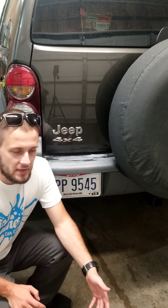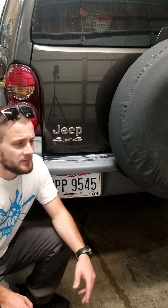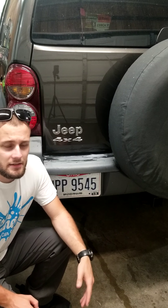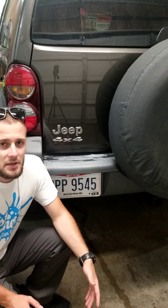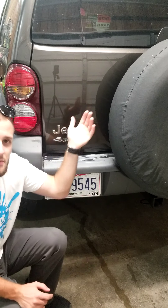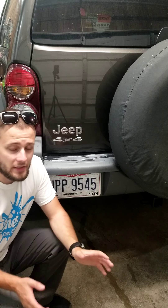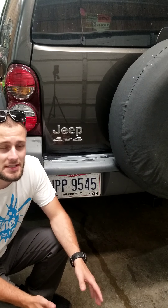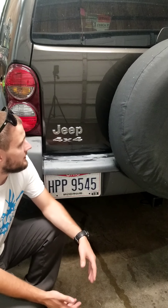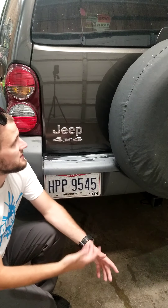Something I've had happen quite a few times is a client would say, 'I had XYZ person do my car, it looked really great for three or four weeks, and then it looked like they waxed it while it was dirty — I started seeing all these little tiny scratches.' Well, that's because wax is a lot like makeup. Wax will fill in the pores of the paint, and then as it breaks down over time — a legit carnauba-based wax is only going to last you a few weeks, maybe a month at best — and then you're going to see those small imperfections.